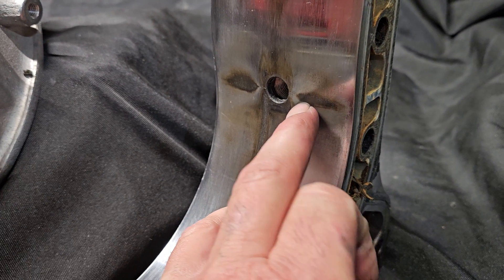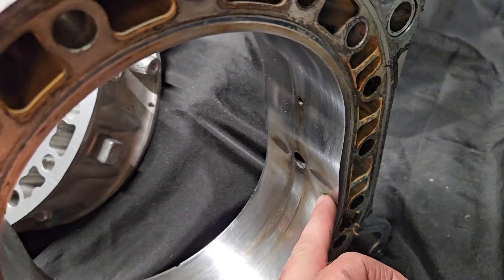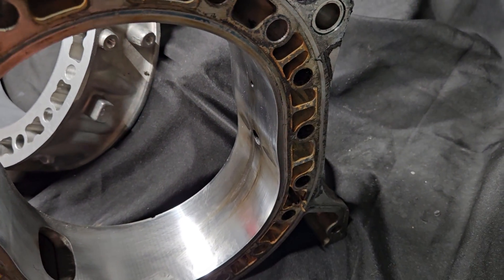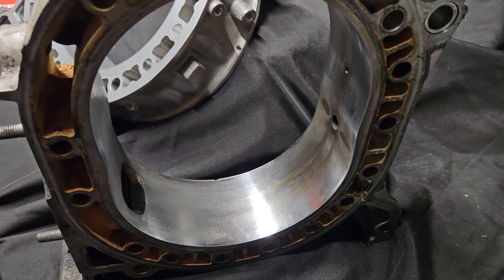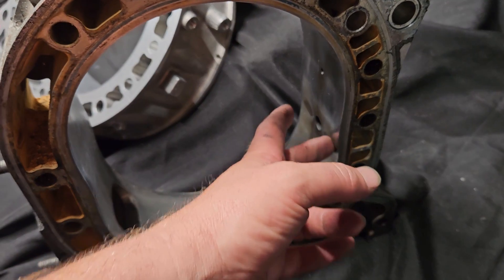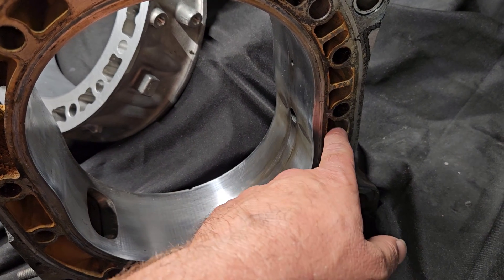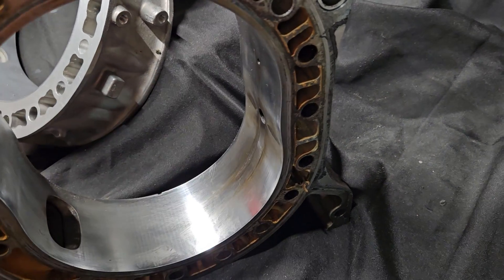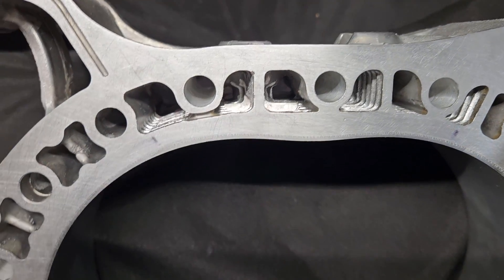Repetitive cracking is a sign of excessive heat buildup or some type of failure within the cooling system. You have to remember that as the water is flowing through a rotary engine, it's coming down the spark plug side first, around the back plate, and then back up the exhaust side and intake side to exit the block. So you can have a situation where at high RPM you have too much heat buildup and the water is not actually able to cool as it's going past - whether the water is moving too fast or just does not have enough surface area is, I think, the debate.